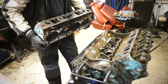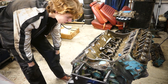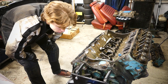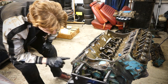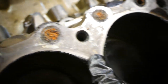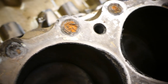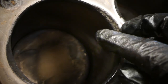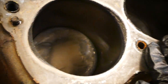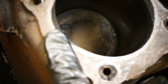Holy shit, these heads are heavy — the heaviest head I've ever lifted. The pistons don't look too bad actually. They're really dirty but I guess that's like 50 years of running too rich. I'm not quite sure what this is — it looks funny how they filled something in, and I haven't seen that before either. There's a little chamfered edge at the top and a few dents in the deck, so we'll definitely machine this down for a smooth surface.